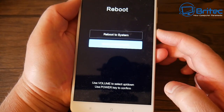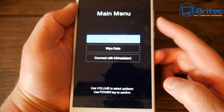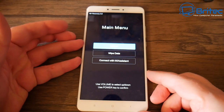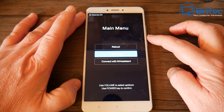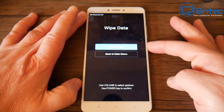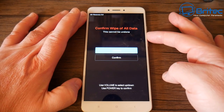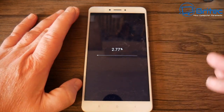Navigate to the back menu by pushing your power button — that's the OK button. Come down to 'Wipe Data' using the volume rocker button. You can also use the menu inside the Settings area if you prefer. We just need to confirm that we're going to be wiping all the data on this device. Come down to Confirm and click the power button, and this will then wipe all that data.